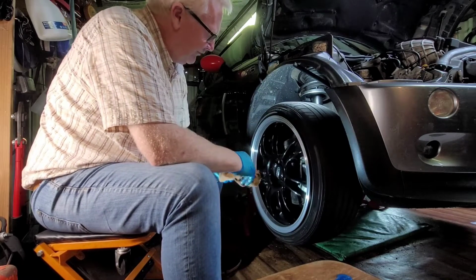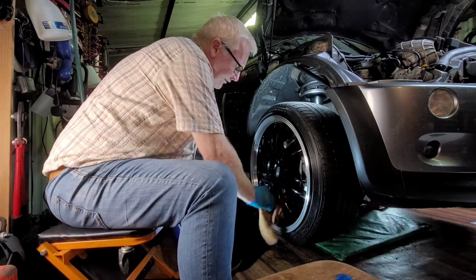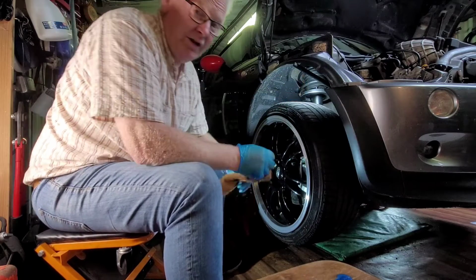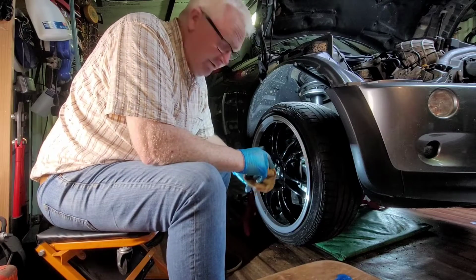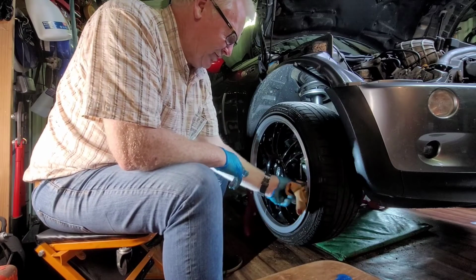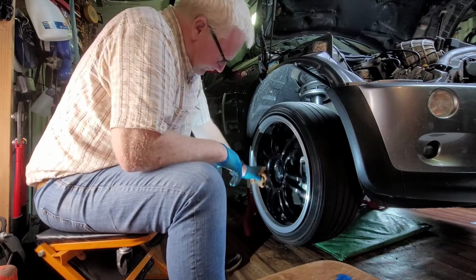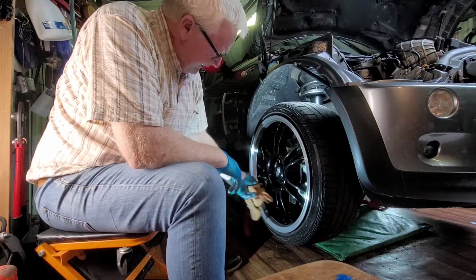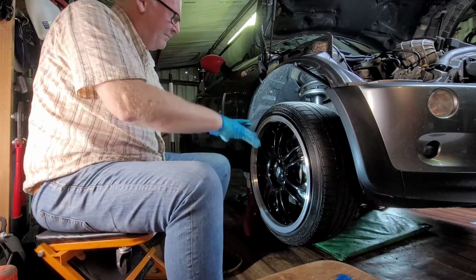Believe it or not, I think I said this when I picked up the Mini after its mods. If both of those dampers were totally kaput, both of them gone, it'll still pass, because there's no difference between the two. That's how they measure, which is wrong in my opinion. It's the intensity of damping. That's the purpose, and that's why it's called a damper. It dampens down, steadies the whole car, stops it from bouncing all over the place.